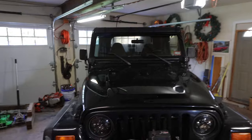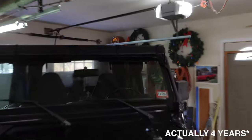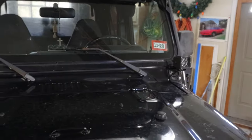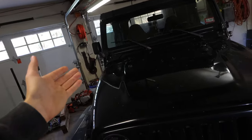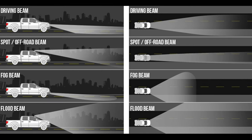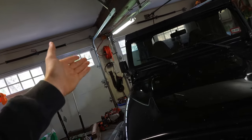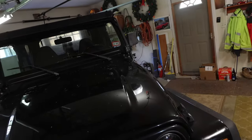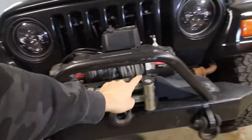I've had this lighting setup for about two years — the large 52 inch light bar across the top and the aux beam pods that are actually fog lights down below on the pillars. In case you're not a Jeep or off-road person, fog lights are not supposed to be up that high because they create a shallow pattern. You want a spot pattern up there. Those are fog lights — I didn't know until after I had them on, so I kind of just left them on there for looks. What we're going to do is take those aux beam fog lights and put them on the front bumper.